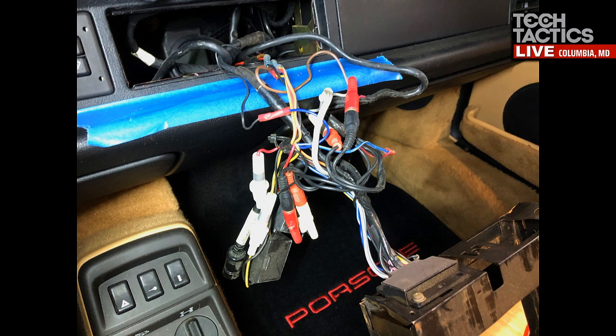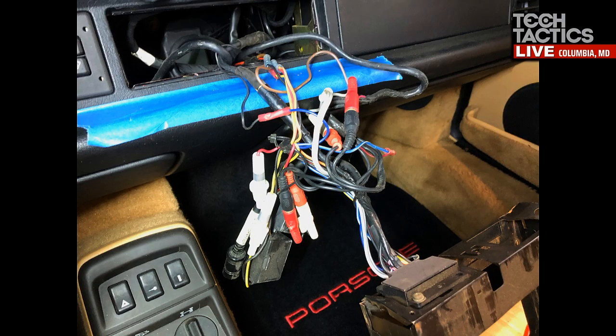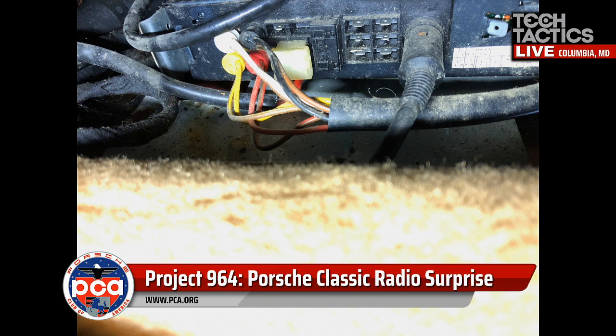But when I saw the wires, there's a spaghetti that you see there. What the previous installer did was they chopped up the factory DIN cable and put RCA plugs onto it. And then it was fed into the factory radio. And then, of course, the new radio that we have here just has speaker level output. So I haven't done this in a while. Although I was in car audio for a while, I sort of panicked.